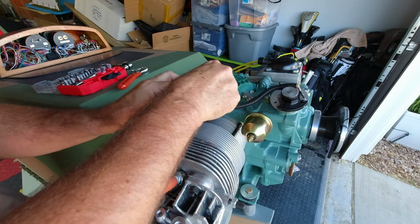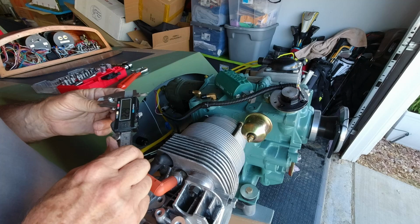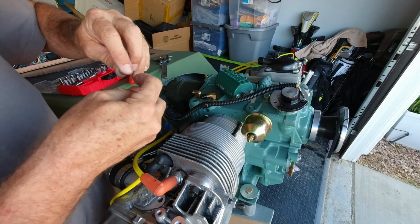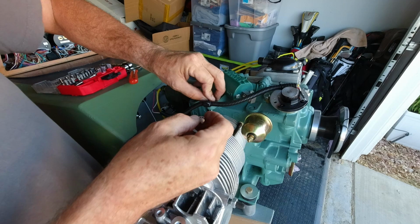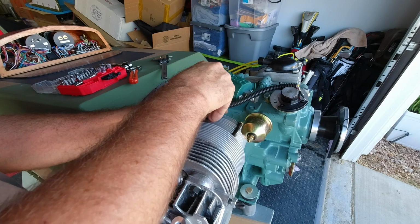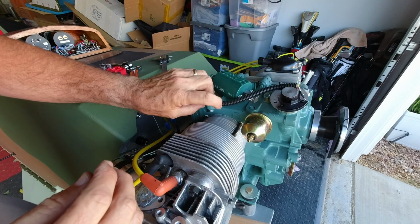And this bolt is basically a quarter inch, so slightly under a quarter inch, but that's okay if I use a quarter inch terminal. 6.2 millimeter, which means I'm going to need another terminal, which I don't have, for a quarter inch for 12 gauge wire. So that'll be a yellow terminal. So I'll just loosely put this back together, so we don't lose anybody.